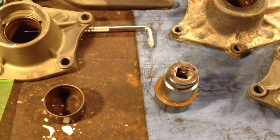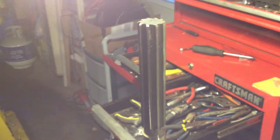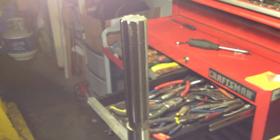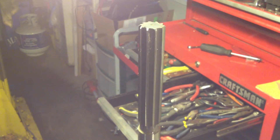And you are done — press it in. Once it's pressed in, find a reamer or an expandable reamer to the size you require, and you're done. Make sure the end covers are washed perfectly — oil galleries and all, blow it out, clean it through before reassembly.